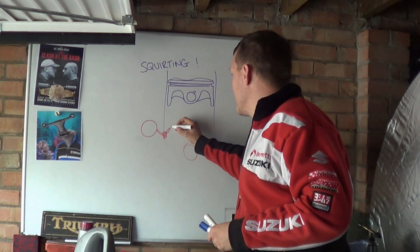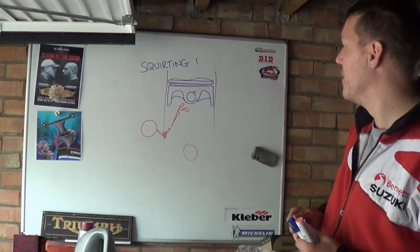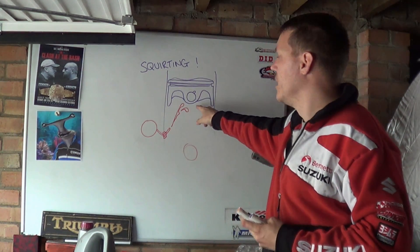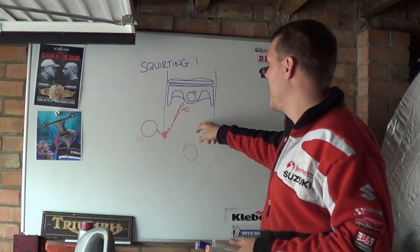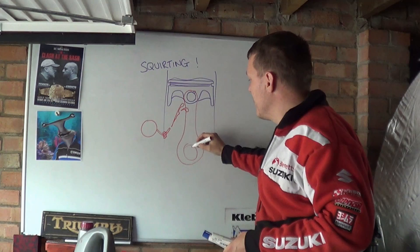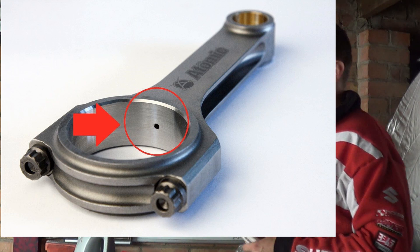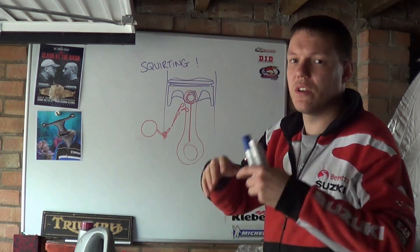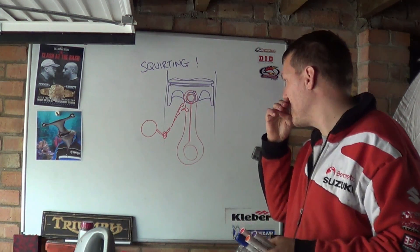And what are they used for? Well what they do is they use high pressure from the main gallery and they squirt oil at the bottom of your piston. And why do they do this? Number one, oiling obviously — because you want to try and oil your wrist pin. And sometimes, or a lot of times, you have a conrod with an oil gallery that comes all the way up the inside of your conrod and actually does a job of oiling your wrist pin. Just having oil everywhere — this squirts, it hits the side of your cylinder walls. It can also be used to lubricate your cylinder walls and stuff.